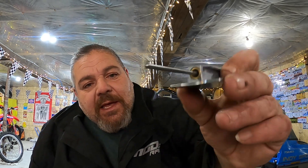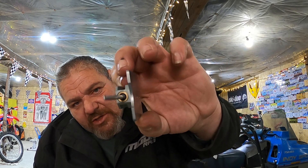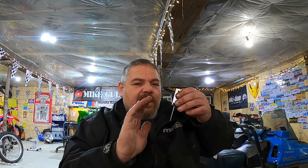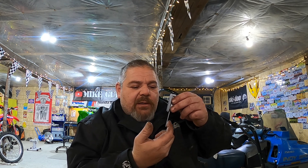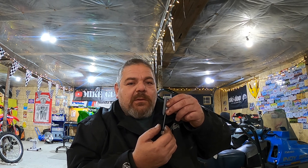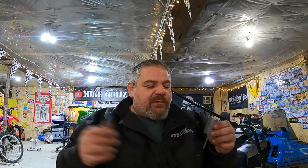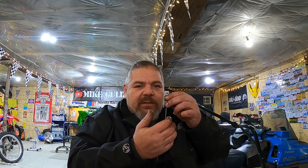This is your metering rod right here. One side is machined flat, the other side is round. The round side sits at the back towards the intake, and the flat side sits towards your engine. What happens is the air comes through and it creates kind of like an eddy — the air goes around it and comes back and hits this rod. The rod creates a bit of pressure and that determines how much fuel is brought in from the bottom. So depending on your altitude and temperature, you're gonna have different air pressure hitting this metering rod, and that determines how much fuel gets in. The bike should run perfect and pretty much sip on fuel.